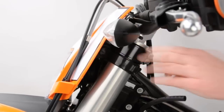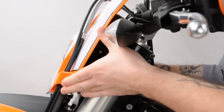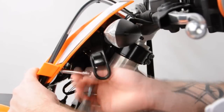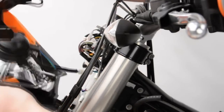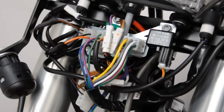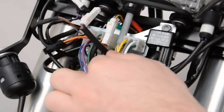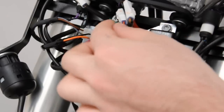Install the provided Trail-Tech jumper. To do so, we will have to remove the stock headlight, exposing the connector bracket on the face of the stock triple clamp. Release the fork straps found on the right and left fork tube. You will also need a 6mm socket to remove the cable guide and disconnect the headlight from the stock wire harness. With the stock headlight removed, locate the 2-pin switched DC power connection on the OEM connector bracket found on the face of the triple clamp.